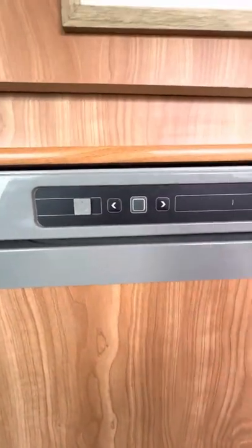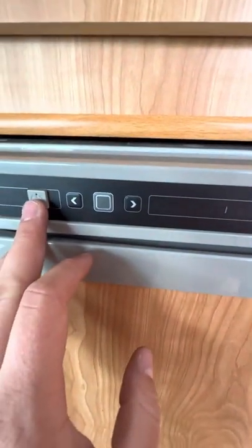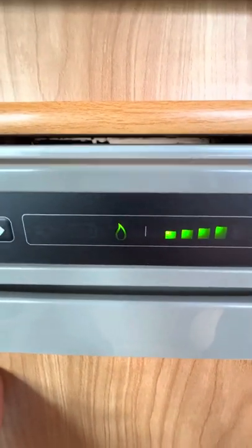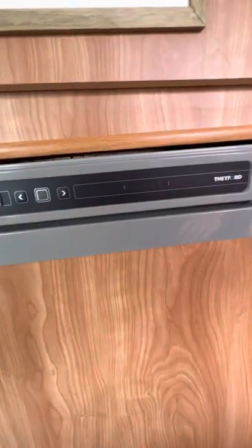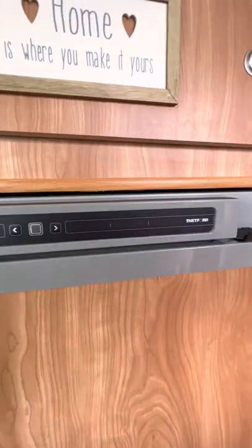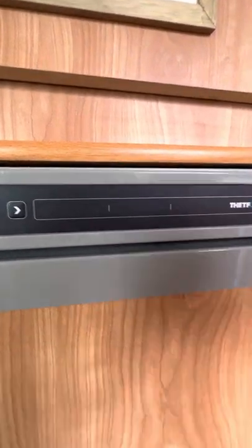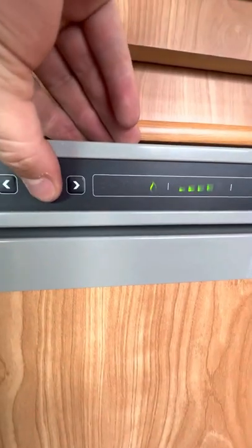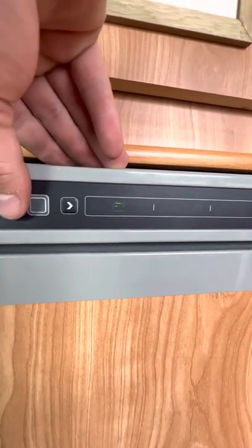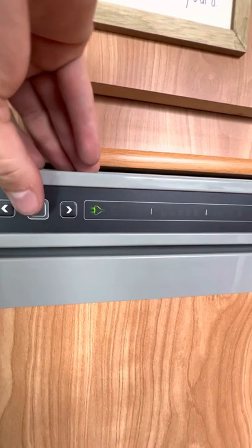The fridge is really simple. Push and hold this button — lights come on straight away, it's chosen gas and lit up. Basically it automatically selects an energy source for you. Press this button once to see what energy it's using — you can see it's on gas, flame level four. To change it, push and hold the button until the gas flame symbol starts flashing, then flick through: that's 12V (engine running), and that's hookup (when your hookup's plugged in).